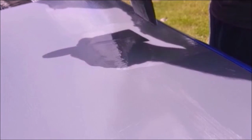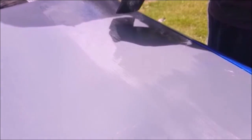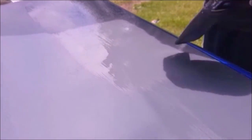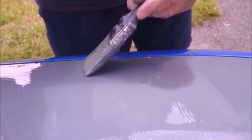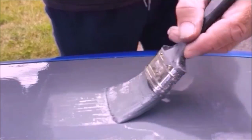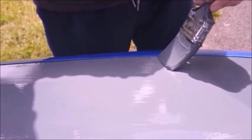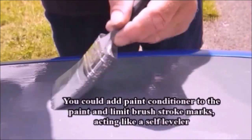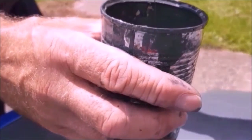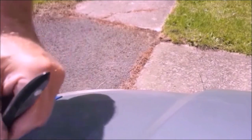So a little 6 to 9 inch square, nice and thick. Don't scrimp on what you're doing. There. So two coats like this should easily be enough. That's just a little 6 inch square. Marry it up to the last one I just did. And I really don't care at all about the brush lines. We can take most of them out with the laying off brush. Again, don't wipe the brush. Get the paint onto the brush and then onto your work surface.